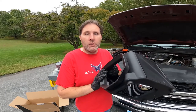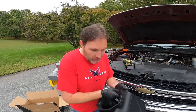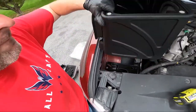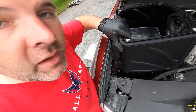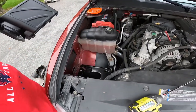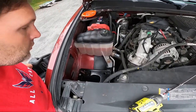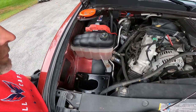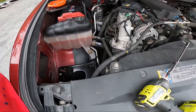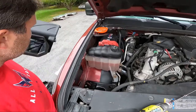I've got the fender grommet on the box, the pipe grommet on, and the bolts mounted at the bottom. I am having a minor issue — this space here just doesn't seem to want to fit. I've been playing with it for about 15 minutes. In the picture, that coolant bottle looks different. It looks like if I just undo the three bolts holding the coolant bottle in place, I may be able to slide it out of the way a little bit. I've already moved the AC line a little bit to get just a tiny bit of clearance, but it's just not sliding in.